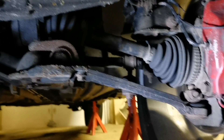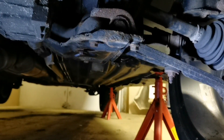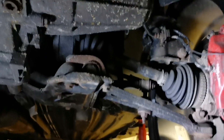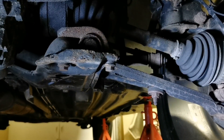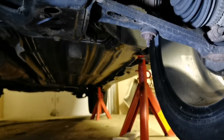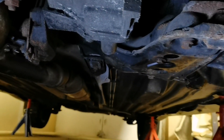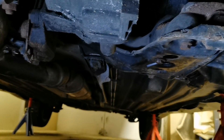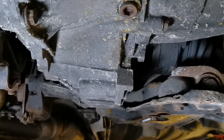Let me explain the thought process behind mounting the Tesla engine. There's no steering shaft in front of or under the sump — it's at the very rear of the engine compartment — which is really good. That makes it possible to use the Tesla small rear engine, because it sits lower in the engine bay, giving me more room for batteries over the engine in the engine compartment.